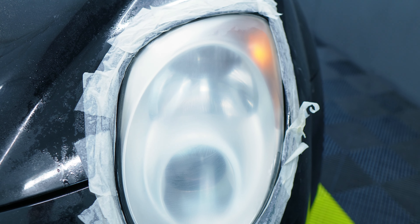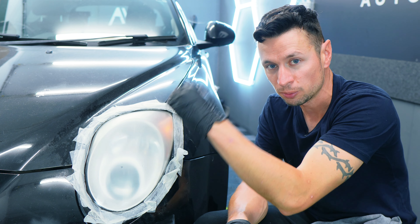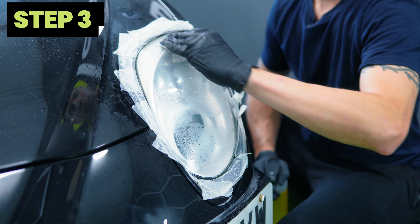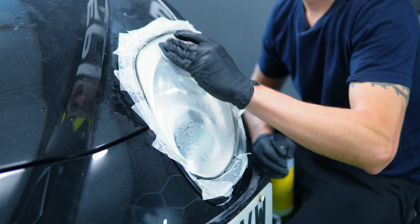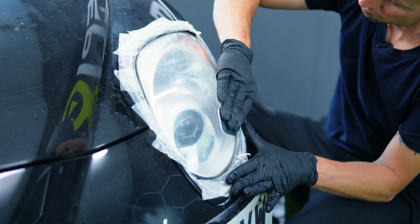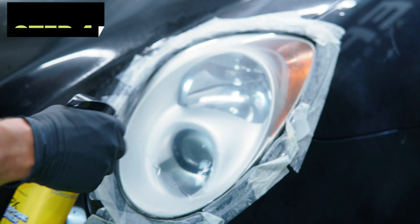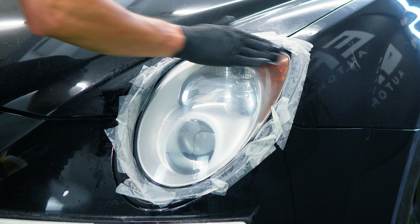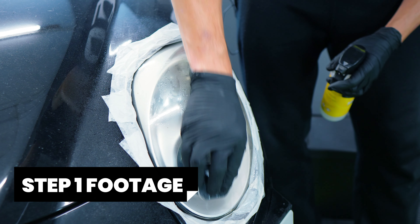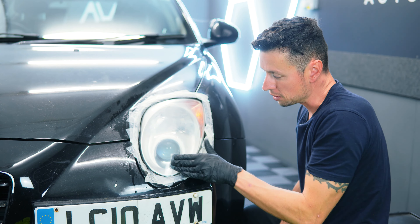We've still got a very hazy headlight, but at least it's starting to look even. Now we take number three and go up and down again, repeating the process exactly as we did with step one. For step three, be extra thorough and careful not to drop the sanding pad as you approach the edges — you may need to pinch it. Also, keep washing the pads if you want the best performance out of them. At this point, you can really start to see it coming together. Give it a quick wipe over, then move on to step four — going left to right one more time. Back in step one, all that white crusty dead coating was coming off the lights, and now there's nothing on there — it's literally just water. We've gone as far as we can go, so now we can move on to the polishing stage.